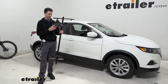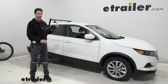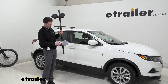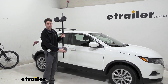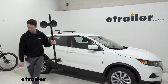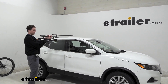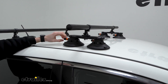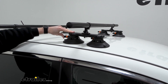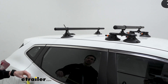To start the install process, the first thing we need to do is to clean our roof, which we've already taken care of. As you can see, we already have the back crossbar set up. Next, you're going to have to remove these plastic covers — make sure you keep them around, because you will need to put them back on when the crossbars are not in use. So I've got all of these removed, and now I can place the crossbars roughly where we need them to go. Make sure these orange indicators are facing backward. That's still going to make them easier to press when we need to figure it out, but right now we'll get a measurement to figure out our crossbar spread.